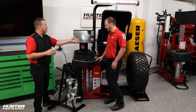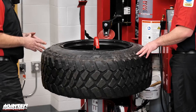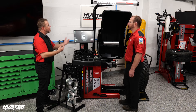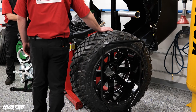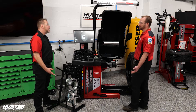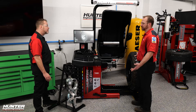We've got this large reverse drop heavy 4x4 custom tire. We're seeing these all over the road right now — you drive anywhere, everyone's got these on their truck. They're expensive, they're delicate. We've gone over the procedure in a past video on actually using the Maverick to do that tire correctly. But this is going to take a different approach to balancing because of the size and the spacing. A lot of shops don't balance them or they balance them incorrectly, so we're going to show you the Hunter HD Elite tackling this project for an accurate overall balance so they drive smooth down the road.